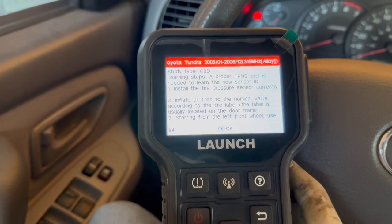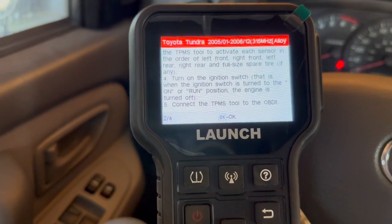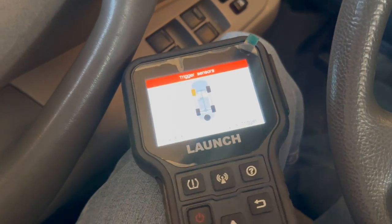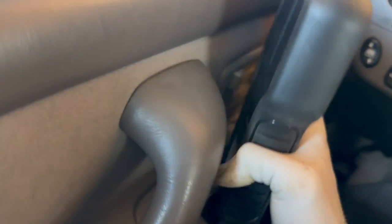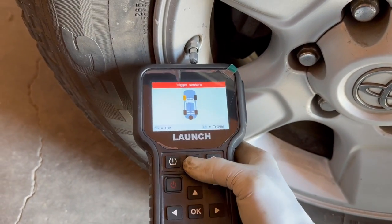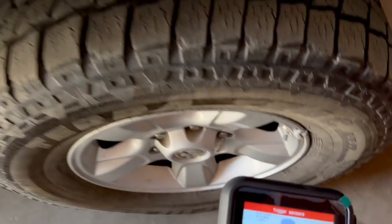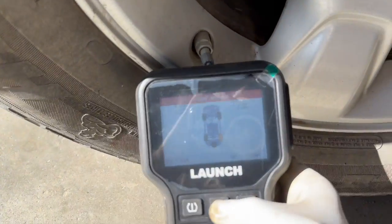It's really just a guide showing you all the different things you can go through — it's self-explanatory. We're just going to hit OK and now it's ready for us to get the data. I'm going to use the trigger button to go get all the sensor data. You just come up to the sensor, hit the trigger button, and do that to all the sensors on the tires. What it's doing is activating them and making sure they're reading — it's going to give pressure readings on all the tires and store the data in the tool.